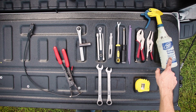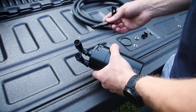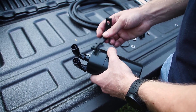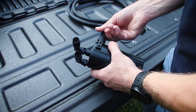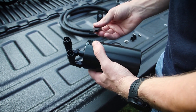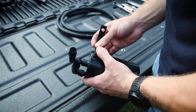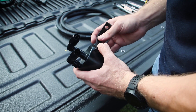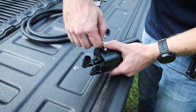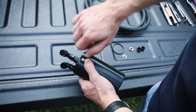You'll also need some lubricant to insert the hose into the AN fittings. The first thing you want to do is mount your bracket. This can be mounted either this way or this way, or on the other side as well, but we're going to mount it this way. We've already checked our mounting location and this is the orientation we want. You're going to insert these two provided screws and tighten those down with a three millimeter Allen key.